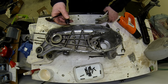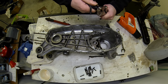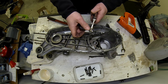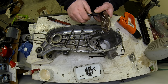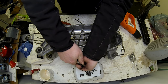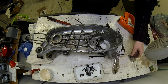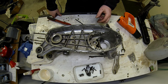Wound that down so far on the tool that I have to use the old vice grip to take it off. Because I'm not using these studs, it doesn't matter. So those stud extractor tools, they do make life a little bit easier. I mean, if you're just going to do the odd one, then of course you can double nut it. But it does go pretty quick with the old stud extractor tool.